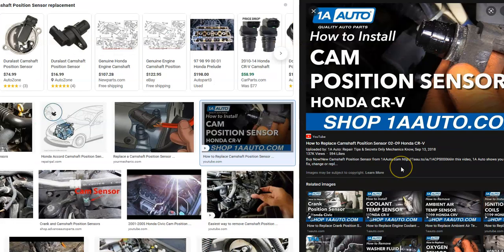So what do you do if you have a Honda with the P0344 code? First, Google where the camshaft position sensor is on your Honda. Check the wiring — be sure the wiring is good, use a meter if you have to. Check for any blown fuses. If all that looks good, go ahead and replace the sensor, and that should solve the problem. This code is usually involved with one of those three things. I just wanted to give a quick overview of what you could do and how you go about fixing it.